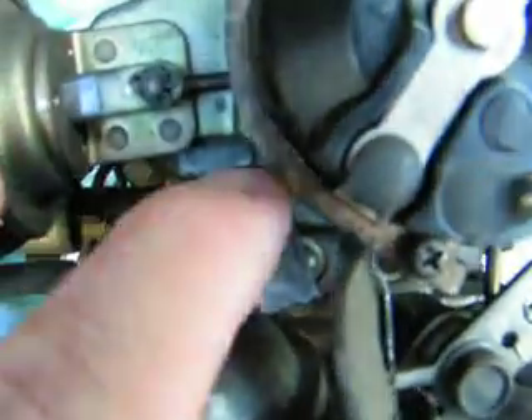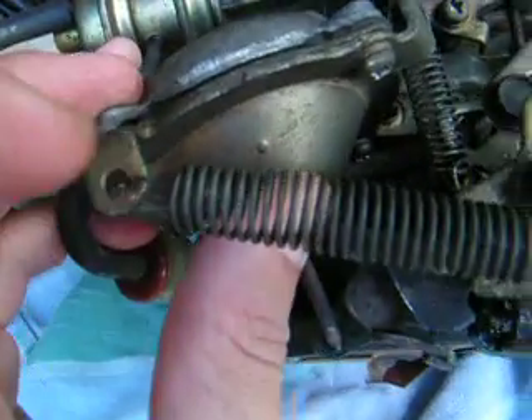You know that side's gotten a bit dirtier. So what I've done — the free mod — is take this vacuum part off your carburettor. Two screws there. You need to release these springs here. Just one end with a pair of pliers will do so you know how to go back afterwards. Put that spring there.